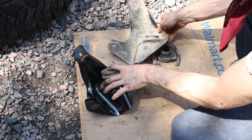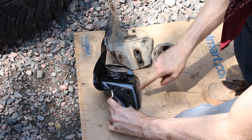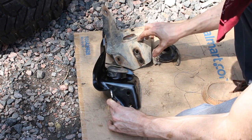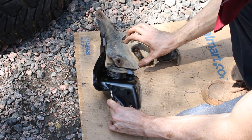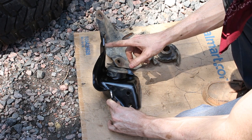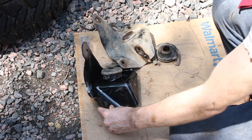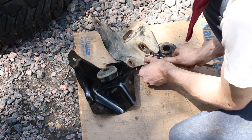One thing I do notice right off the bat is that there's 2 different hole sizes right here and right here, because I think this Bronco had factory bolted on the right side, the passenger side. And there's like a factory piece that kind of has two welded bolts on it that go through here, and they're bigger size holes than the standard rivets if you have those. And so I want to keep that piece because it helps for assembly. And so I'm going to drill these guys out to 5.9. It's almost 0.6.